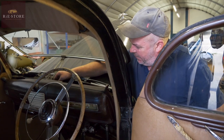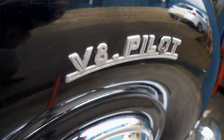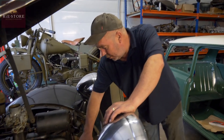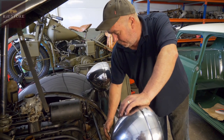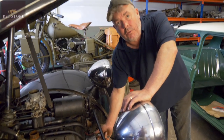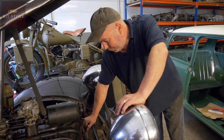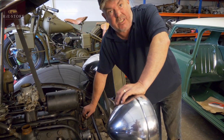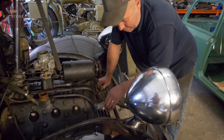So what do you know about this car? Never worked on one before. Gordon's getting an electronic distributor for it — electronic ignition — because once the radiator's in, the distributor cap goes on and you can't get to adjust the points without taking the radiator out. Get the electronic one and you don't basically have to touch it again. The water pump is also the engine mount.